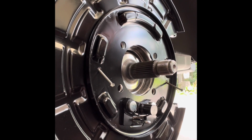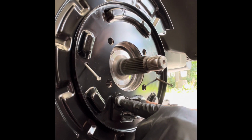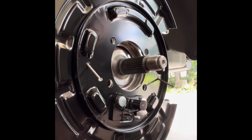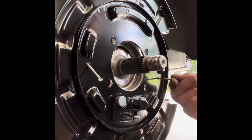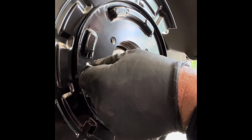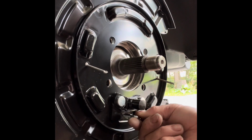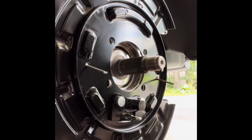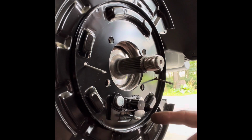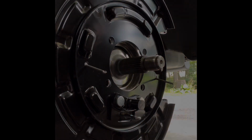All right, so shield's on. Those little parking brake bolts here actually hold it in place nicely, so I don't have to kill myself. So basically put the brake shoe pins back in first, then put this on. Remember, your parking brake cable has to stick through, and then bolt said shield back in place. We'll start with these 2 bottom bolts back here, 17 millimeter.